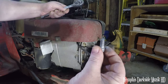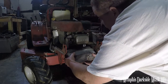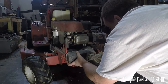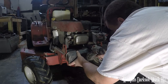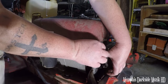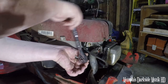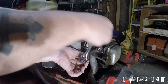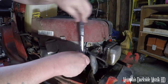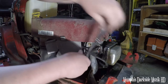The easiest way I find to do this — just get the bolt started like that. It's going in a whole lot smoother and easier. Remember now that we're working with aluminum here, so you don't need to crank down on these bolts.